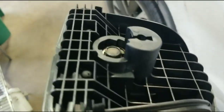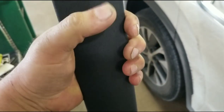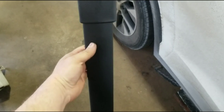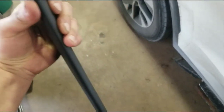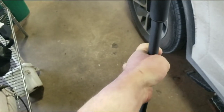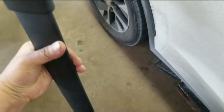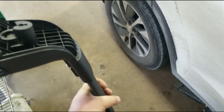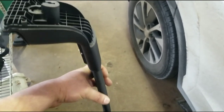I'm going to get the other end off and get it up on top. I loosened these bolts up here — I didn't take it off completely, but I loosened it. You can see one side is thicker than the other, like an airplane wing. What you want is the bigger side facing the front, like you would see on an airplane. If you go the other way, it's probably going to cause a lot of wind noise. That's the way you want to get it on there.